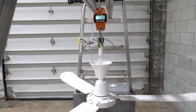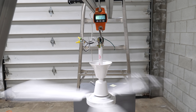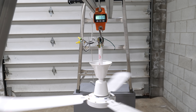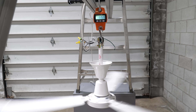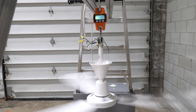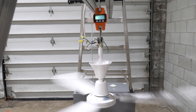That's a different number in kilograms. And once it's up to speed, the scale reads 11.2 pounds — so it got three-tenths of a pound lighter, or 136 grams. But not so fast! Keen-eyed viewers may have noticed that the scale jumped up slightly once the fan started. The twisting force it was creating on the scale did skew the number a bit. When first switched on, the fan appeared to gain 0.14 pounds. And when I unplugged it and the twisting force from the motor was alleviated, the scale briefly read 11.02 pounds — so the fan appeared to lose 0.18. If we split the difference and add 0.16 pounds of thrust, then the fan actually got 0.46 pounds lighter, or 209 grams.